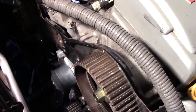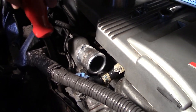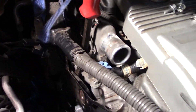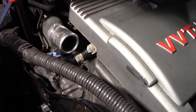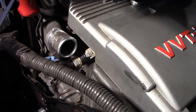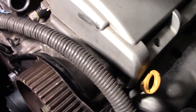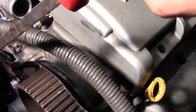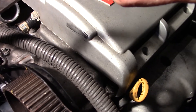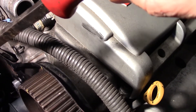I had to take out those two bolts that were holding the cover and then maneuver the cover around a little bit with a pry bar here, over where the bolts go. I was able to get the gasket and the pump on — you'll have to do that if you're not going to take the cover off — but we got it on, and now I'm going to start buttoning up the water pump.